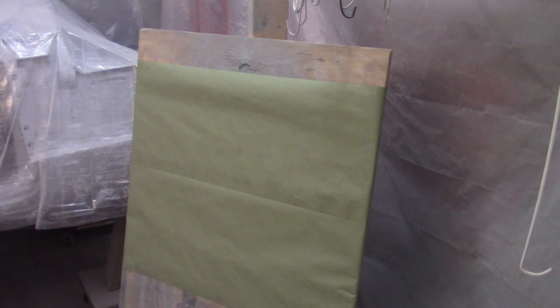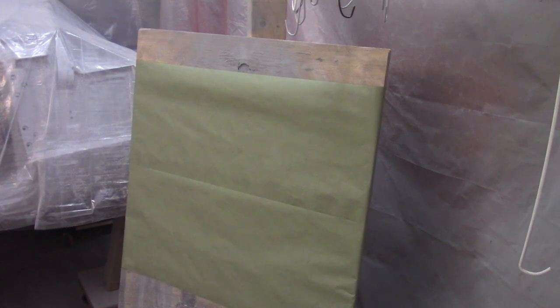I've decided to switch gears a little bit. I just don't have it in me today to block and do all that. I was working on the Z fender all morning. I figured as I was going through and learning to paint I'd teach myself as I painted, so I'm struggling a little bit with dry spots. What I really want to do is use the gun here with a 1.3 millimeter tip full of lacquer thinner — I know it's not quite the right consistency — but I want to get a feel for air pressure adjustments and go broad and see what happens.